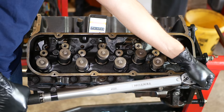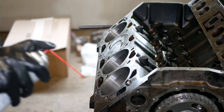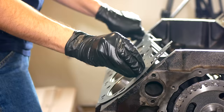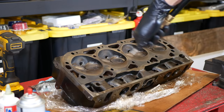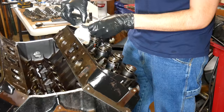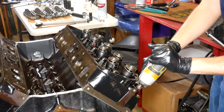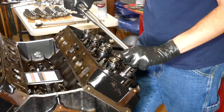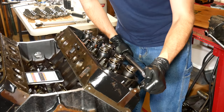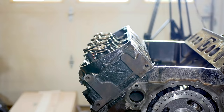And 16 clicks later the driver side head is fully tightened down, so it's time to get excited because we get to do all of that again on the passenger side. We'll spray, wipe, and blow off the deck surface, drop on a new head gasket, unwrap, spray, wipe, and blow off the cylinder head, and try not to throw my back out while plonking the head down onto the engine block. All of the bolts get oiled, sealed, and dropped into place and then snugged down. Then we'll start with a first pass of 30 foot-pounds, go through a second pass at 60, and finally a third pass at 80 foot-pounds. With that, all of the bolts are tight and both cylinder heads are installed.